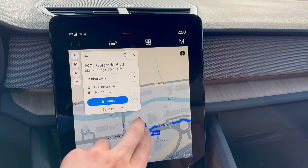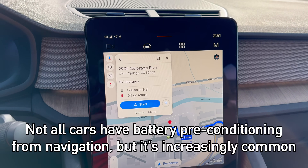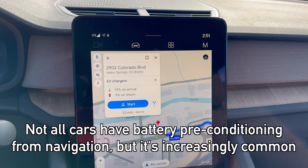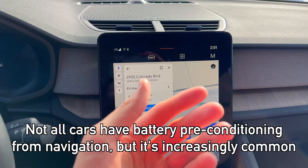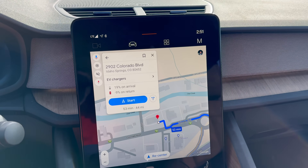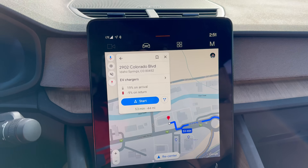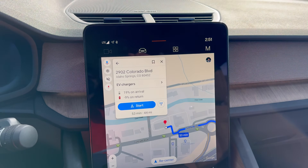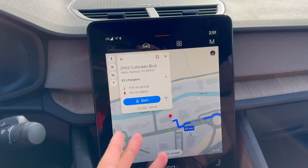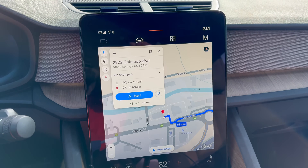The car doesn't recognize the chargers are there even though I know these are DC fast chargers. I'm going to arrive there with 19% anyway. Normally if I was pre-conditioning, it would use a little more juice to warm the battery, but I'm going to try to drive and use regen to heat up the battery manually on the way there so I'm not stuck with a slow charge speed. These chargers are capable of 200 kilowatts, which is more than my car can handle, so hopefully I can realize close to my car's maximum charge speed.